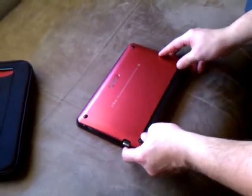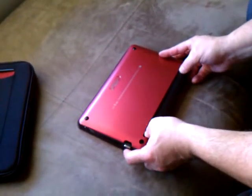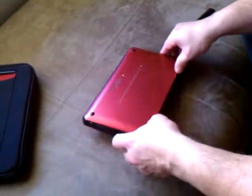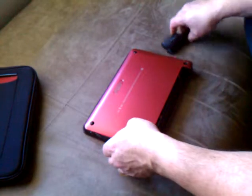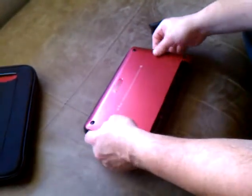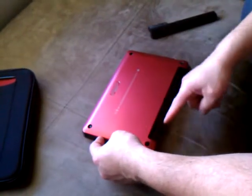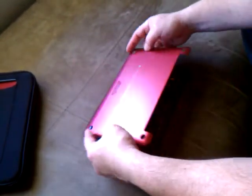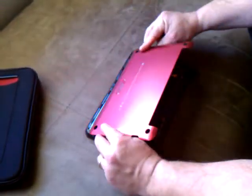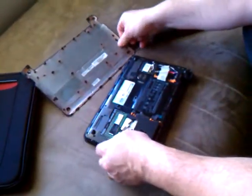I'm going to show you how to take the hard drive out. First, you take the battery out. The cover's already loose because I want to make sure this video goes nice and smooth. It does take some time, but reach your fingers underneath and pop this. It's better to go around the side of where the battery is because these have clips that have to go in first, so it makes it easier to pivot up and down. So we're going to take that off.